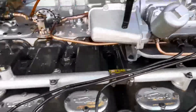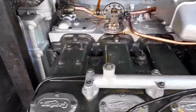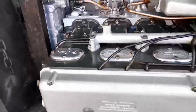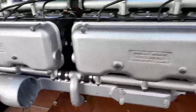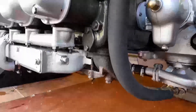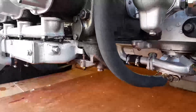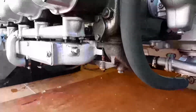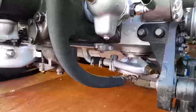This is just a quick overview of the engine in its horizontal position. You can see the lift pump there and the complexities of the copper work. The rocker covers, as I explained earlier, have the special seals. That water pipe there is really quite interesting — originally it was a long pipe to the thermostat at the rear end of the engine, but here it's at the front.